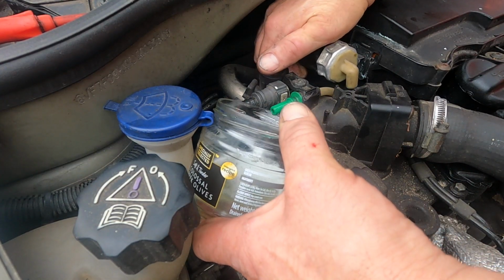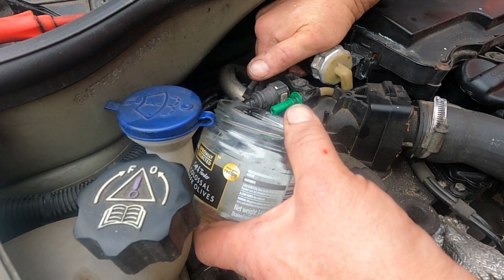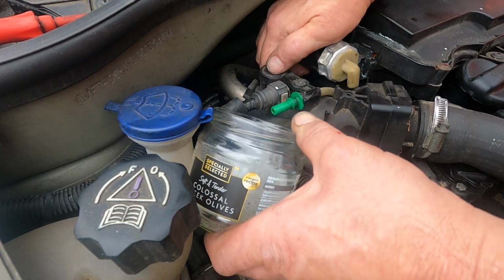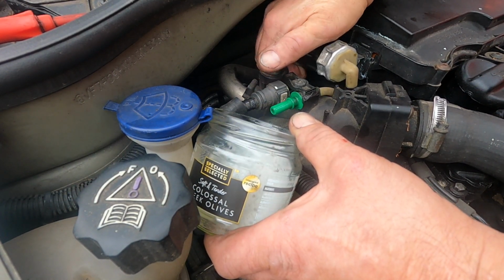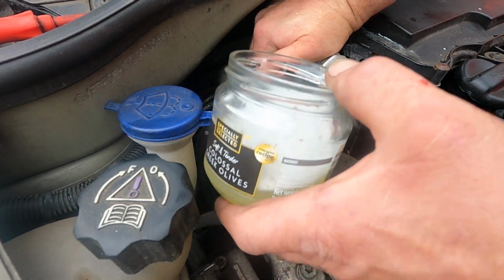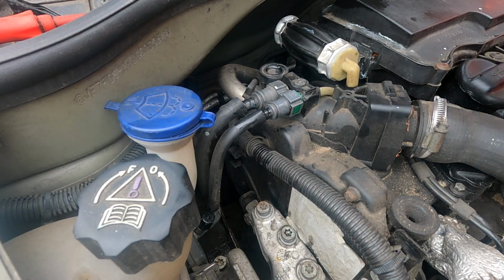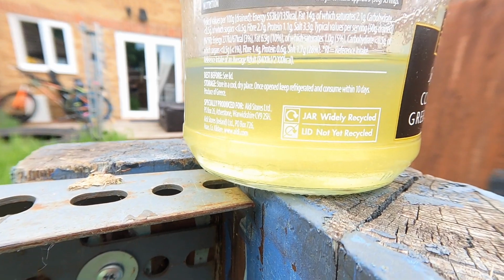So anyway, let's talk about diesel fuel. This is what the video is about, and water in diesel fuel. My particular system on this Citroen is a bleed through the leak back, so I'm going to take some diesel out here, and I'm going to add some water to it, so you don't get the wrong impression. I always keep my fuel system nice and clean, but you can see the frothiness here. That's only because diesel froths when it gets pumped, doesn't it? That's the leak back on the vehicle system, and that's the only way I can prime it up and bleed filters, through that primer.